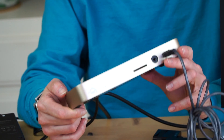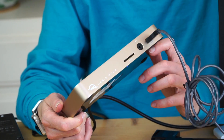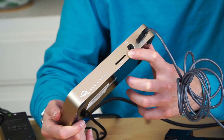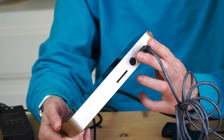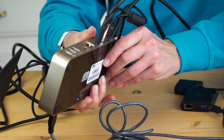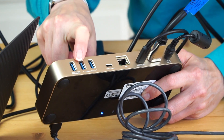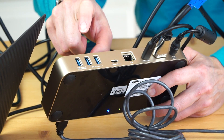On the front, we have an SD card slot compatible with UHS Type 1 high-capacity SD cards, a combo audio jack, and a USB port currently plugged into a keyboard. On the back, there are lots of cables attached — three more USB ports. Now these are USB 3.1 Gen 1, which look just like the USB ports you're used to — USB 3.0. A lot of people think USB 3.1 means USB-C connector, but USB-C is a connector type only.